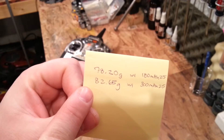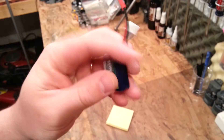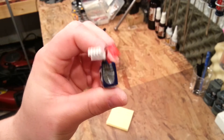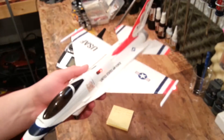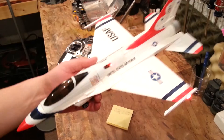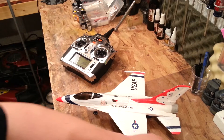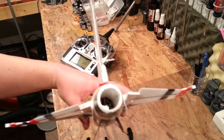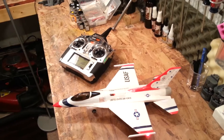So we've got these two weight readings as a baseline. What I want to do is jump it up to a 3S pack — 180 milliamp nanotech 25 through 40C discharge running on a JST connector. I've already tried running this plane on a 3S configuration and it did not handle it. So I know I can't do it on the stock setup. On UMX EDF planes you're generally not going to get away with it — I killed my Habu doing that. Let me show you what I'm planning on doing and we'll see if it works.